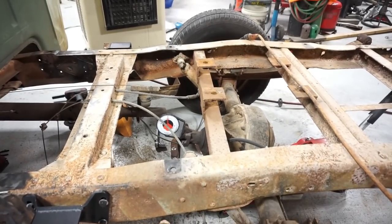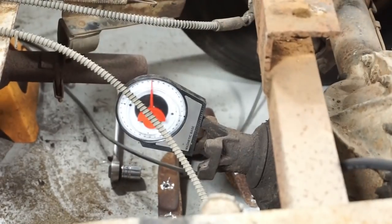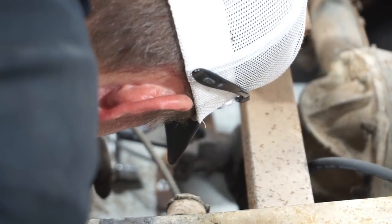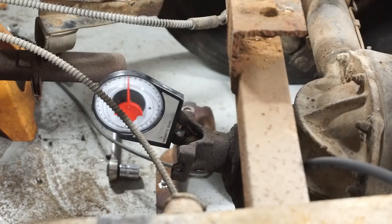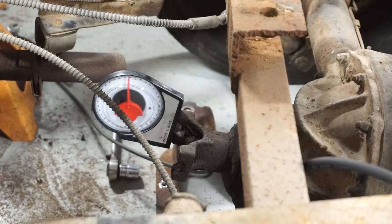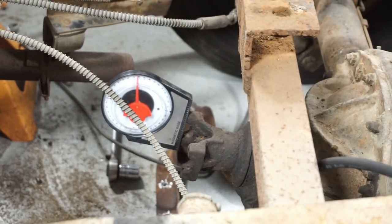That pinion angle - I didn't touch the gauge and we're at 70... 78. So 78 to 84 would be what, that's six degrees. So we're kind of where I was hoping it would be. I wonder if the six-degree pinion blocks would fix this and make it okay.